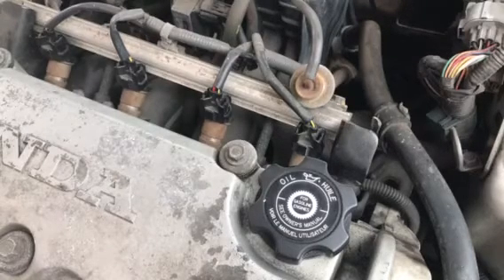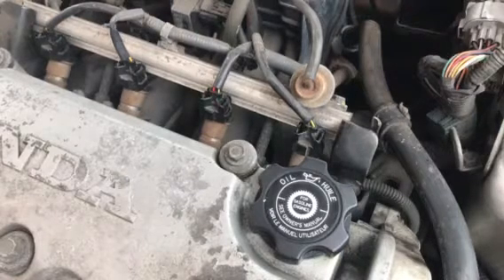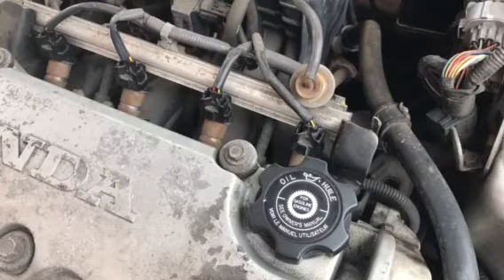Basically, it's more to do with wiring integrity more than anything else. It's just that if you feel like you've got a dodgy injector and you've got a code come up, it could be a circuit problem. It's just some of the things to look for that I go through anyway as a DIYer before having to take it to a shop and get some proper scopes or Picoscopes on it for proper diagnosis. But some of it could be staring you right in the face.